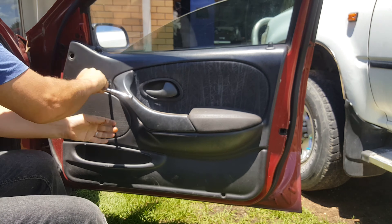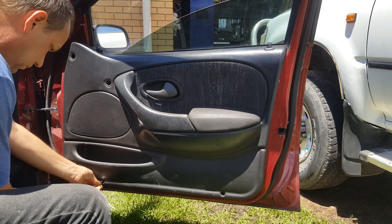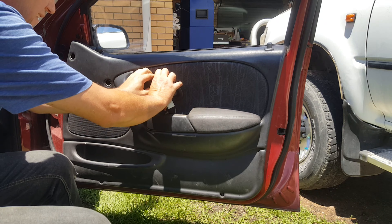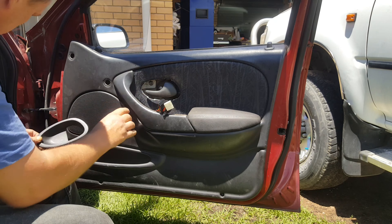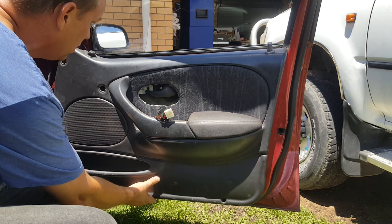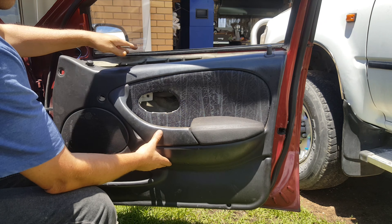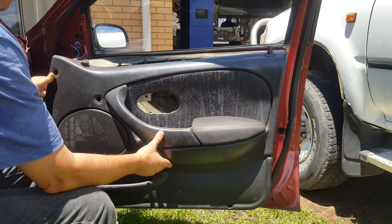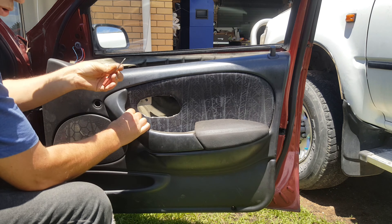There's a Phillips head on that side, a screw on the end, and a 10mm right there. You can tell I've never had this card off before, otherwise I'd know more about this. She falls out — oh look at how easy it comes off now. I need to get this power connection first, and I also need to unclip the connection from underneath the door handle. This clip doesn't have anywhere to press, so I'm using a small screwdriver to slide in and unclip it.